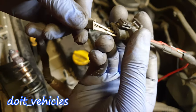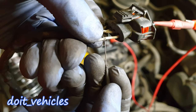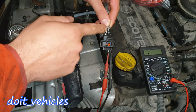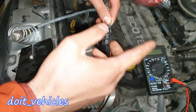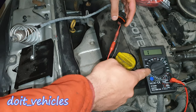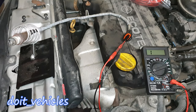I want to show you something I noticed: down here the wire is a little bit damaged — it is almost wearing through the plastic cover to the wire itself. Another test you can do is measure resistance between the ground and the signal wire — the one which sends either 0.1V or 0.9V to the PCM. Between these 2 wires, not the heater wires, you can read the resistance; this time I'll set it to 2 million ohms.